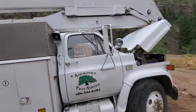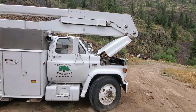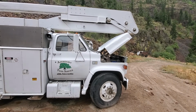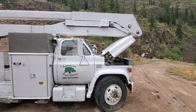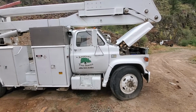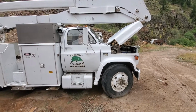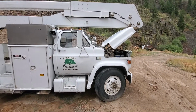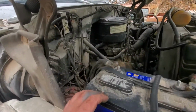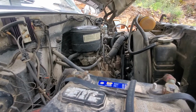Oh, dang it. Well, I'm not going to break off exhaust manifold bolts right now. I'll get underneath and see if maybe it's the manifold collector that's loose and I can get a donut for that. It sure doesn't sound like it. It sounds like an individual piston that's got a blowout at the bottom. But I'll give that a look. I'm sure that's why these were all anti-seized, that someone else was already in here trying to fix the problem, and they did the same thing I did quite a long time ago by the look of the gasket.